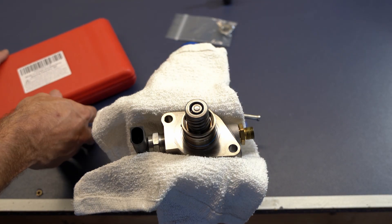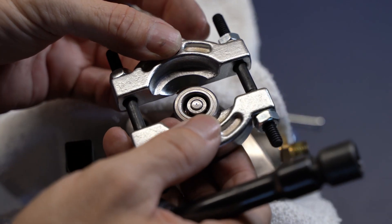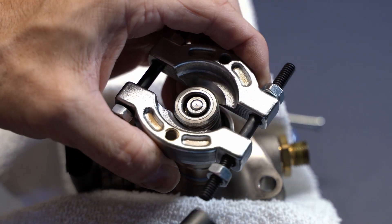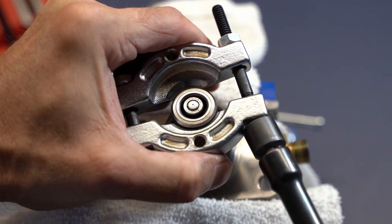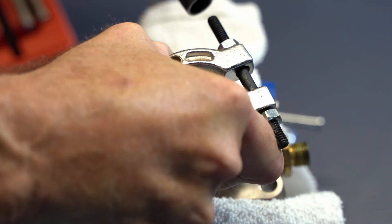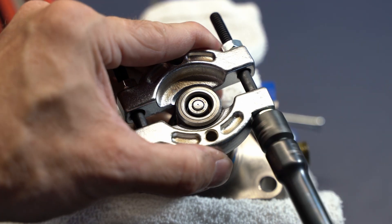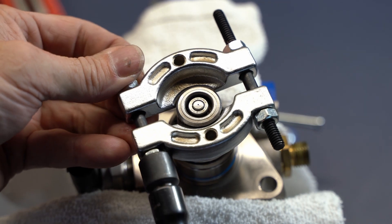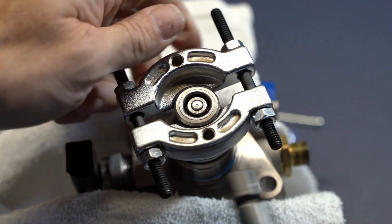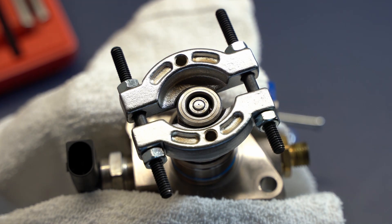How I'm doing this is with a bearing splitter — I got this off Amazon for 25 bucks, I'll put a link in the description. I'm slipping it underneath the retaining collar and above the spring. As you tighten it, you can sort of work it in, twisting and pushing down on the spring. It's not critical that you're above the spring, but a lot of people have been breaking these retainers off. You can also go in between the coils of the spring, but I really liked getting it right on top of the spring up against the retainer.